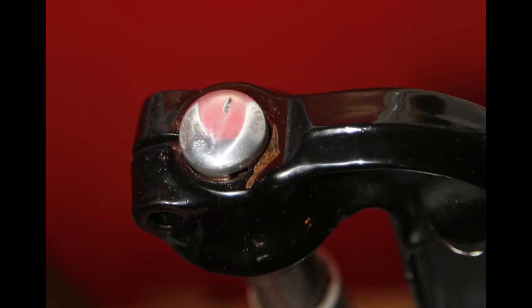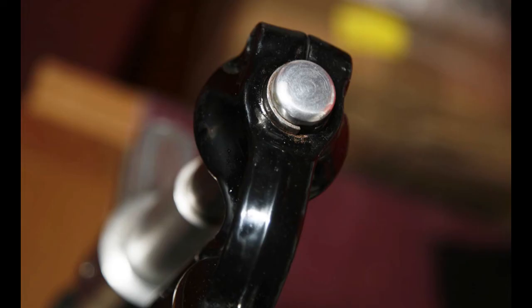That's the left plunger. That one's the one that had some marks on it. And I took the worst of the scratches away, but the marks looked quite distinctive, so I left those on, adds to the character. You can also see copper grease around the frame lug, so that they don't lock in the frame. It's always worth doing. Never put anything in dry, because eventually it'll seize up. You can see at the rear here, this is the other alloy plunger, and there's the locking bolt lug.